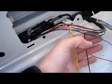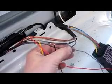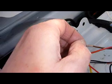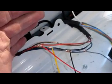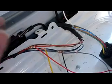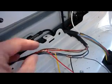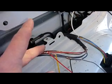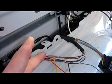The tail lamp clips are living just underneath here — you just pull them out and give them all a little nick with a Stanley knife, like that one there. Then get your tester and check all the wires: turn on your taillight first, then your brakes, then your left indicator — do them one by one. The signal will probably be about 10 or maybe 11 volts.